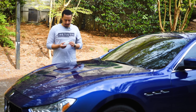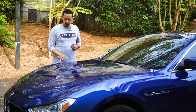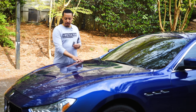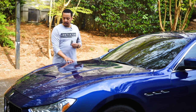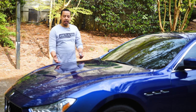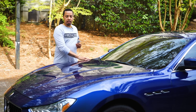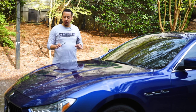So let's break down what this stuff really is. What is a clay bar? A clay bar — it is ideal that you already have a pretty decent paint job and clear coat, because it's not going to do miracles. But if you run your hand over the surface after washing the car, you can feel grit and grain in it — it's kind of bumpy. The object of the clay bar is to rub it over the clear coat, and it extracts and gathers all of the contaminants, those bumpies. When you're done, the surface should feel like glass. This is a fairly new car, 2015, so let's see what we can get from this.